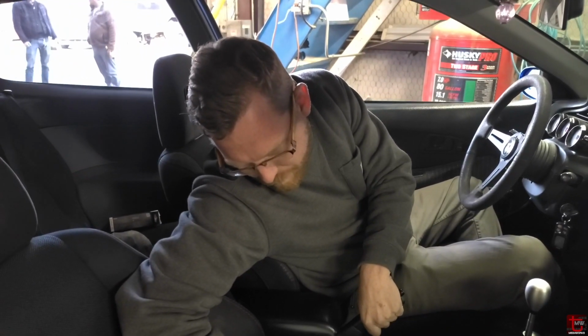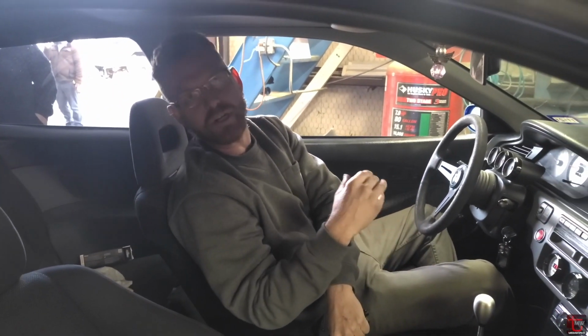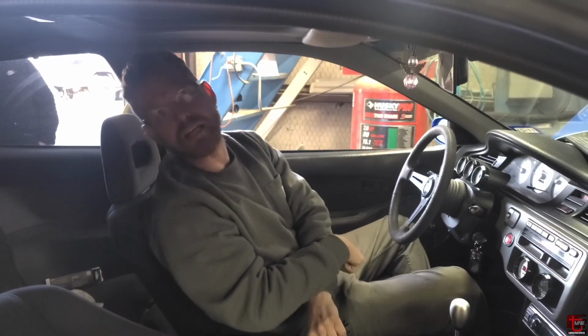So now we're at 88% duty cycle, but the mixture was too rich. So I'm gonna remove some duty, and hopefully, like I said, we'll be in a happy mid 80% duty cycle.